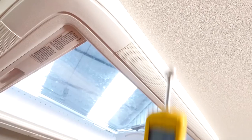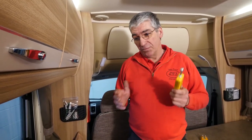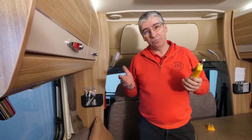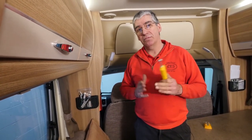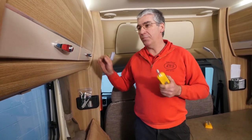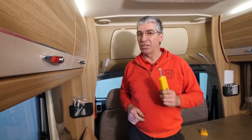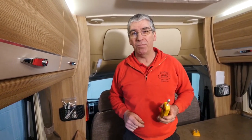Now we'll check for damp. This little device is a moisture meter — it tells us if there's any water ingress into the vehicle. Very important to check for, because water ingress spells disaster. This is a very good reason for having a habitation inspection on a regular basis — annually is typical. The most common places for water to get in are around windows, roof lights, and doors — anywhere where the bodywork has been punctured for a doorway or where the roof and wall meets. So we check everywhere, absolutely everywhere: inside cupboards, around awning fixings. Damp is such a big issue.